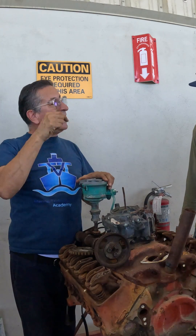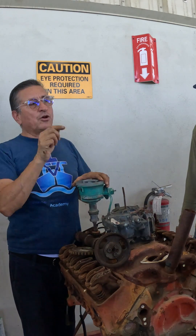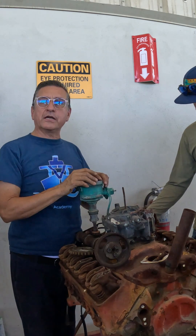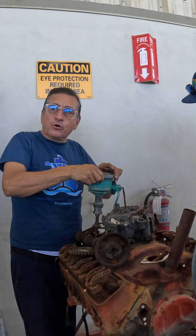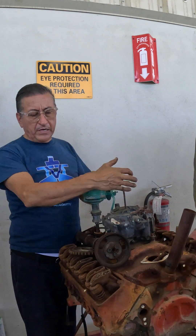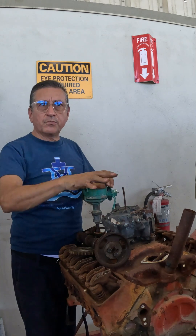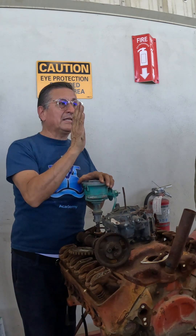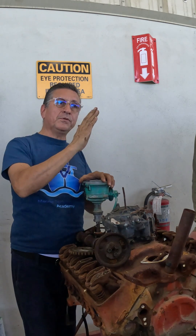In this engine, I am going to put the engine on time. The recommendation — I checked the manual — is 16 degrees before top dead center. Now I put it at zero. Can I start the engine right now with the cable properly installed, everything and carburetor ready? Yes, but it's at zero and the recommendation is 16 degrees before.